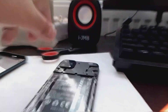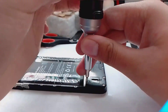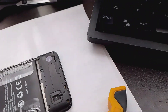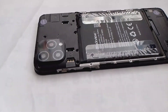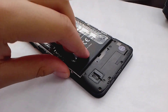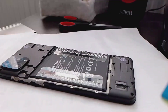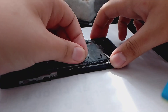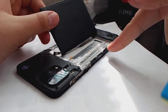Blackview. Okay, let's continue. On the speaker and the charging port and of course the microphone. So we are done, all the screws are removed. This phone has many screws on the case. I'm gonna put it down and open the phone itself. So first let's open and remove the battery. Oh, actually, removing the battery is so easy, you know. That was easy as expected.